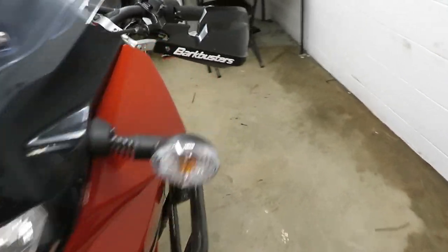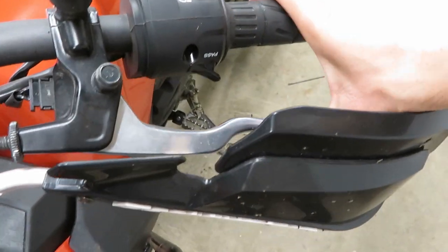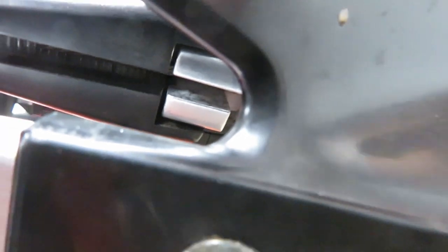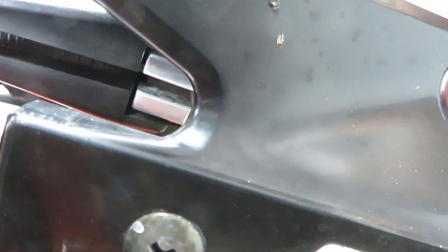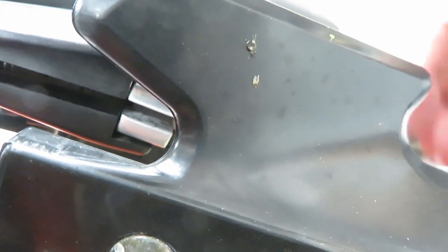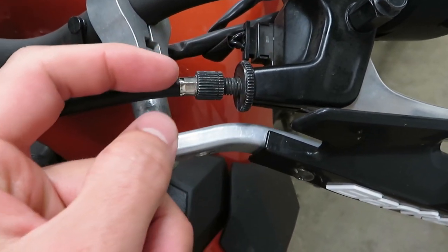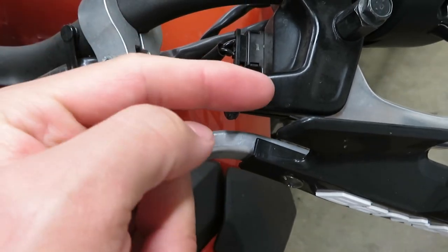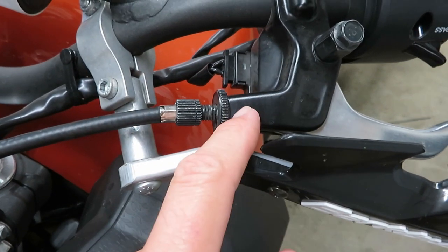On the other side of the bike, give the clutch lever a pull and release — you should have about a nickel's worth of space between the end of the clutch lever and the beginning of the perch. If you tap it forward you can see that closes up. Adjusting it is super easy: crack the adjuster loose and twist it clockwise to add some slop to the setup.